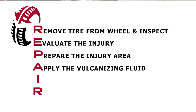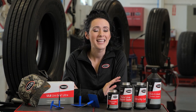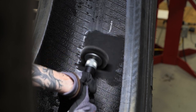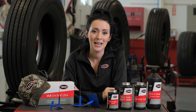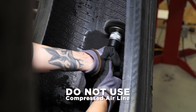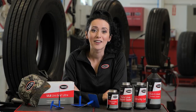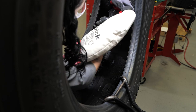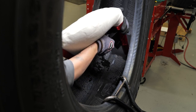The A in Tech's process represents applying the vulcanizing fluid. After you have properly buffed the tire's inner liner, you now need to remove any leftover debris. Using a soft wire brush on a low RPM buffer, lightly brush from the right side of the prepared surface to the left side to remove loose buffing dust and steel shavings from the buffed surface. This is an important step to create a clean prepared surface to maximize repair unit adhesion. You may need to repeat this process two to three times. Do not use a compressed air line for this procedure — the compressed air may contain moisture and oil that will contaminate the buffed surface. Now vacuum all buffing dust and steel shavings from the tire. Avoid contacting the buffed surface with the vacuum, as this can also contaminate your prepared surface and compromise repair unit adhesion.